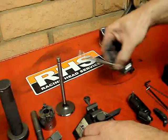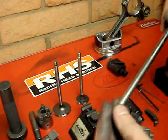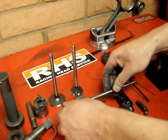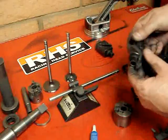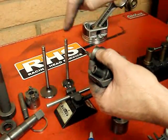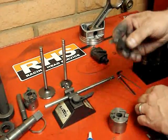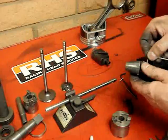Then we're going to remove the valve and install the same pilot that we're going to use in the guide on that cylinder head. We're going to install that here on our fixture. And then we have these seat cutters. These seat cutters have multiple angles on them, so we cut multiple angles all at once. These actually have performance angles on them that are designed for high-performance flow.